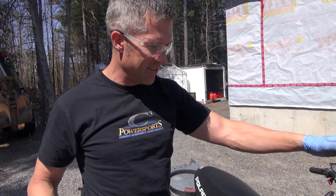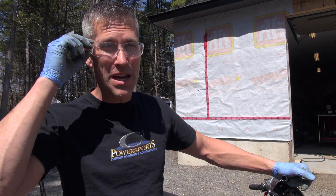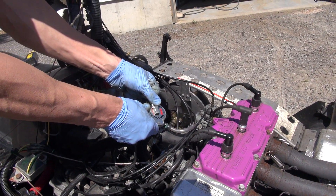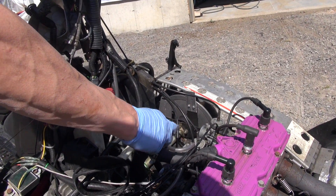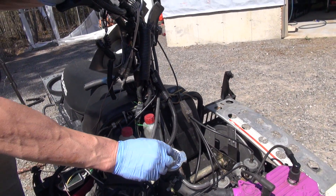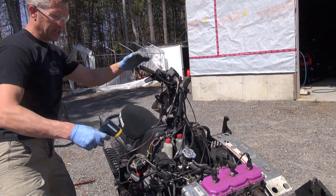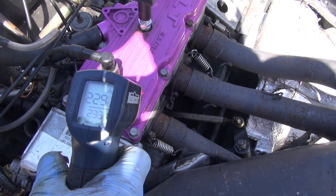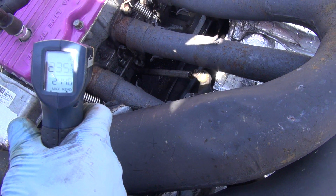260, 265 degrees — I saw it peak out there. It took a long time for it just to get to 220, which is when your engine is definitely overheating — you'll see that red light come on if you're lucky. Sometimes I've had it where they don't come on and fluid is leaking out all over the place. Let's just release the cap — that's at 260 degrees. No kidding, nothing — no pressure — unbelievable. Let's see what kind of sensor reading we're looking at: 230 over here, 244 and 235 — it's coming down now.